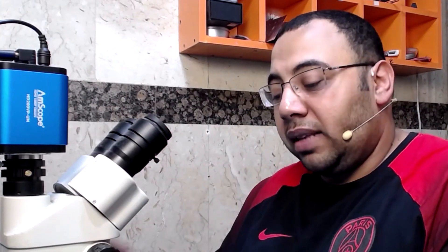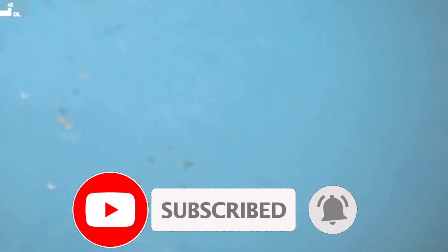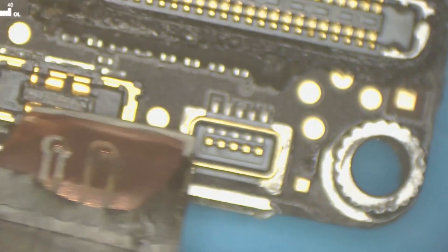Let's check the voltages — the power supplies for the Wi-Fi chip. The power supply for Wi-Fi chips is most of the time VDD main or VCC main, and 1.8V. If we go to ZXW, we can know exactly where to check those power supplies, the inputs of the Wi-Fi chip.